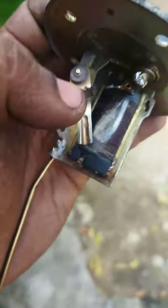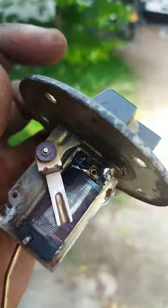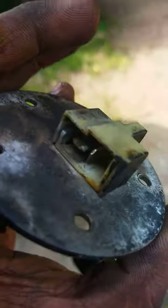If it's not broken, definitely you can repair it. Solder one end here — that is the one going to the coil. It's soldered here and there's a copper part connected to the coil. The earth connection goes to the body and is connected to this floater. Keep a multimeter on resistance settings, put the floater up and down, and check the resistance varying. If it's varying, it's working properly.